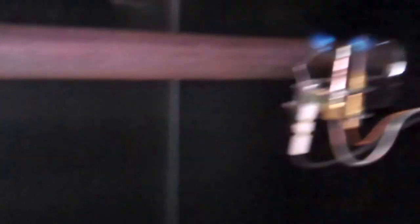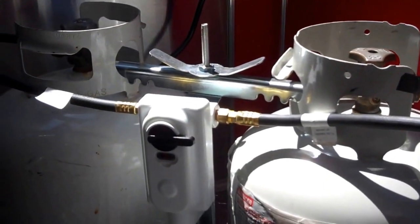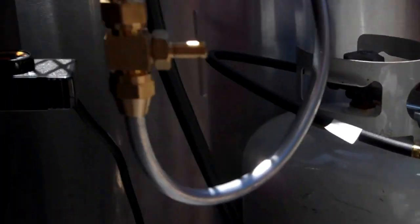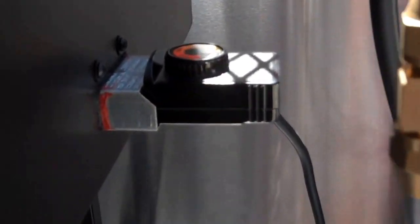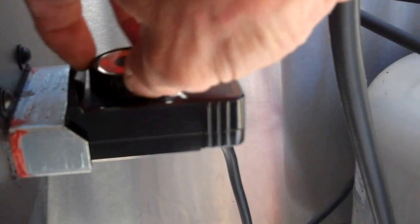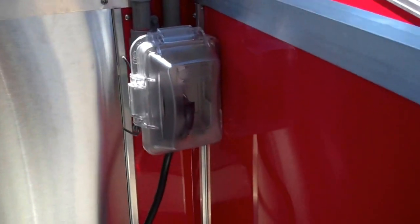If that pilot blows out, this valve shuts off — you have no gas flow whatsoever. That's the safety feature. And once you shut it off, you can't turn it back on. You have dual tanks there — the tanks don't come with it, but the changeover does. You have a valve out here that controls the flame. That right there is what you turn the electric element on with, so you can get heat to it, put wood chips on it, get smoke. And of course it plugs in right here. That's the way the smoker works.